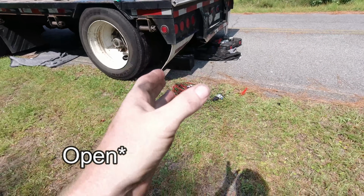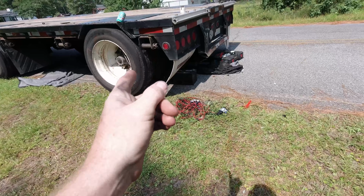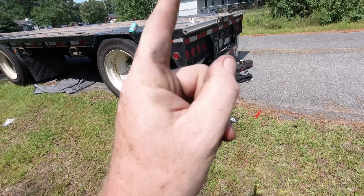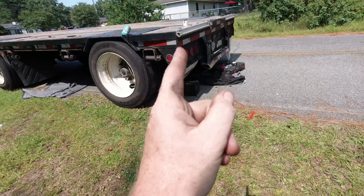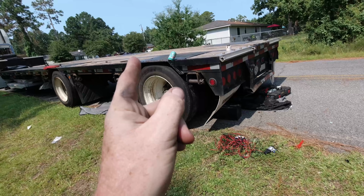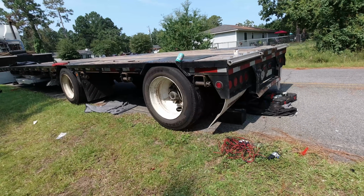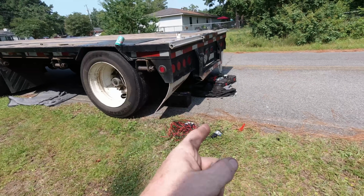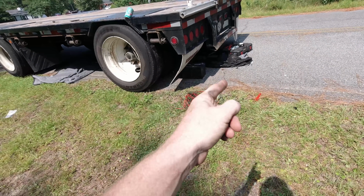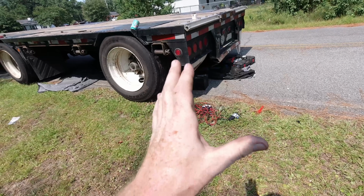Basically what I wanted was to be able to push the button to make it dump. And the way that this one was set up was you had to keep the button on in order to keep your bags filled. And I wanted to make it to where if there was a problem with the wiring, I would always have air in my bags. So I ordered another one. That one was wrong too, so I got online. You got to take them apart and swap them around. I'm still not 100% sure that that's going to work.